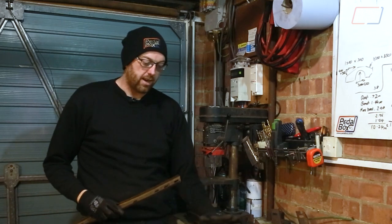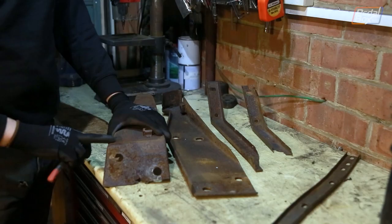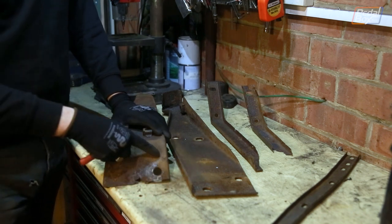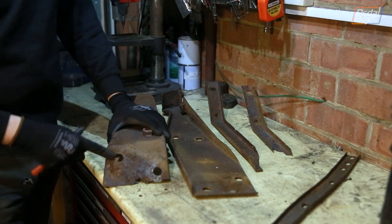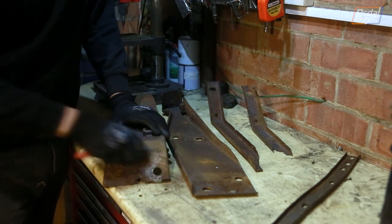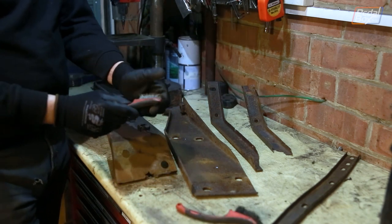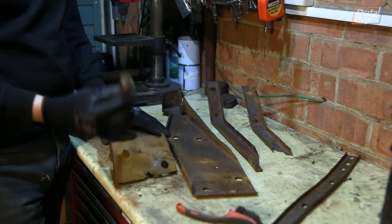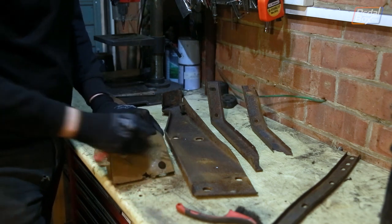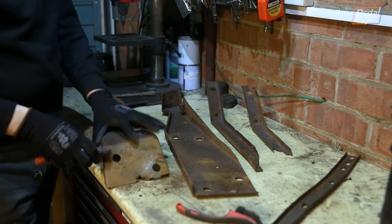Before that I'm going to show you how I cleaned up some of these, because I have done a set already and there are a lot of other bits that have been painted too. Making a start, we need to clean off some of the loose rust and get whatever we can off without using the drill or grinding attachment, because that will launch everything everywhere - so the more we can get off now the better. All I'm using here is a fairly firm steel wire brush, quite a fine one to get into all of the edges, but you can get them in much bigger coarser versions. You can also get bronze wire ones which are much softer, but to get rid of this rust you really need the heavier duty one, albeit in a relatively small size so you can get into all of the inner corners more easily.